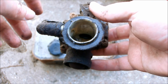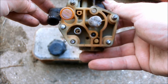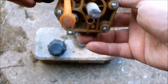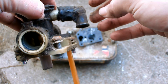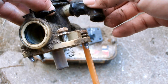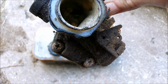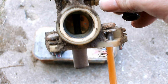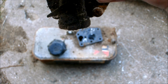And the carburetor is off. You can see in there, I think, just how dirty this is. Underneath, it looks surprisingly clean. A little dirt there on the fuel filter. So I'm going to spray this off. The crankcase ventilation elbow here actually has some electrical tape on it. I'll bet I can find a good spare in my collection of crap. These screw heads, you can probably see, had mud and dirt sitting on them for so long that they started to rust. So I will not be reusing them. But the next step, I'm going to see how this cleans up and probably put it back on my good tank.